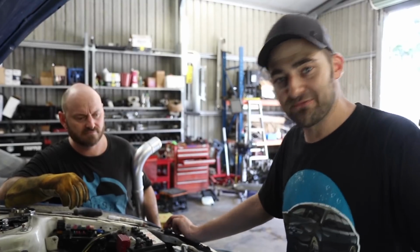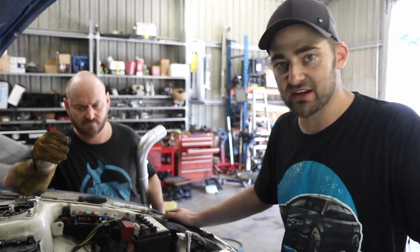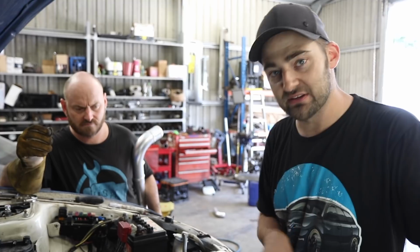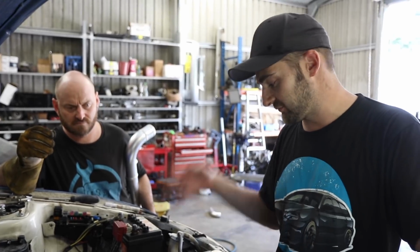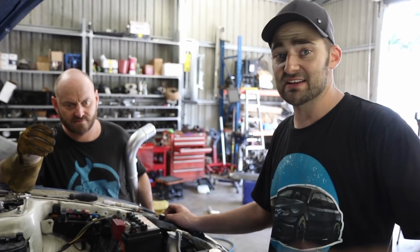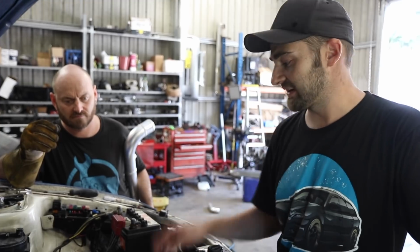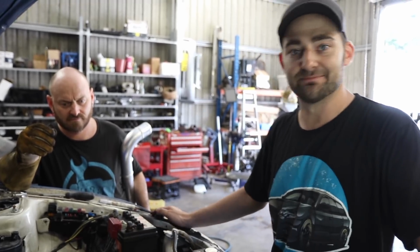Two cooler pipes are finished. But before we put this final piece into the manifold, we're just going to start the car, give it a few revs. We've cleaned out the intercooler, we've cleaned out all the pipes, we've blown them out, we've run water through them, we've done all that kind of stuff, but it's cheap insurance. You want to make sure there's no boost rags in there or anything else that's going to get in the way. You just leave this off, give it a quick rev, check that nothing's coming out of it, and then we can slap our last piece in.